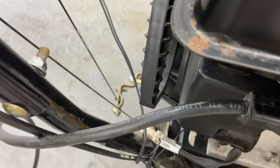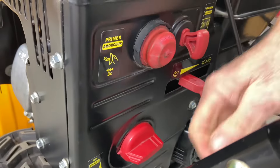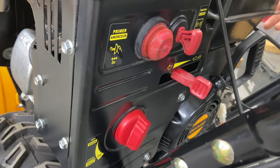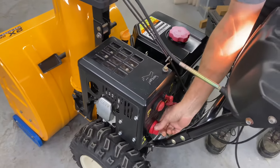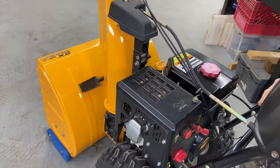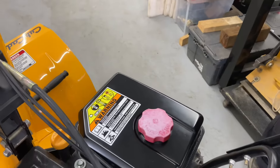Let's plug it in and try to start it up again. I'm going to go ahead and put it on about half speed. We have the button in and choke on. Since I just ran it, I'm not going to prime it because the engine spins fast enough with the electric starter — you probably don't need it. But that's only in really warm weather; this is 40-degree weather, so it's not like it's real cold out. After it starts up, pull your extension cord out of its spot and then you're ready to go.